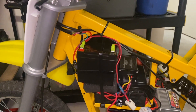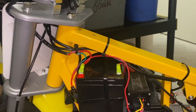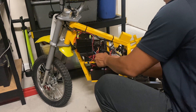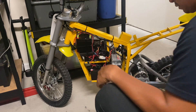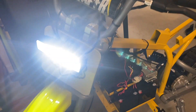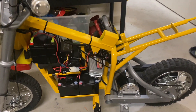One thing to keep in mind if you're planning on doing something like this: make sure there's enough slack in the wiring for the fork to turn left and right. Put a 10-amp fuse in. Let's plug this up, put the fuse in, and hopefully it doesn't catch fire. It works — so freaking bright! Now that everything's plugged in and we know it's working, it's time to put everything back together.